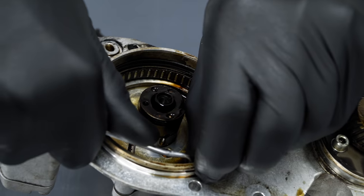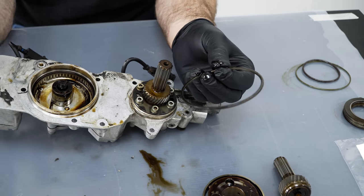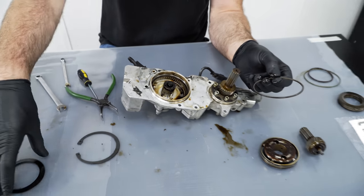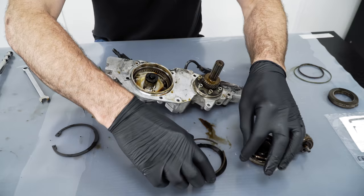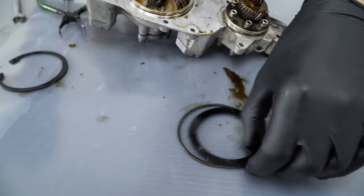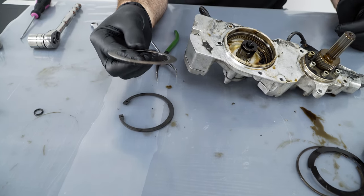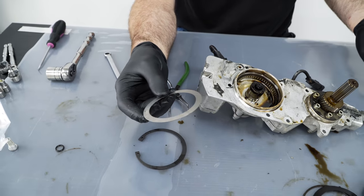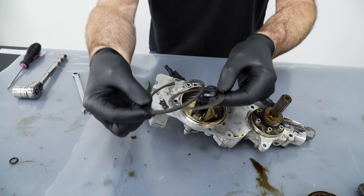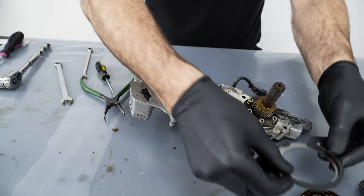Is the retainer for the oil pump. That's an early part. BMW did modify into these at some point in production. But that spring clip basically is the reason why you find that plastic hanging out the back of the unit. So what you do is use the metal one from the E36 M3, which obviously can't break down with time, and more often than not, you find this kind of circlip in an Evo, but occasionally you don't.